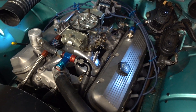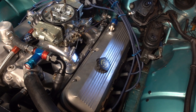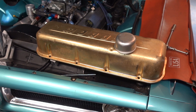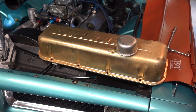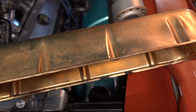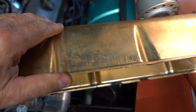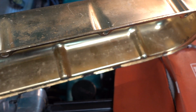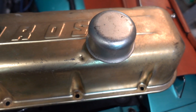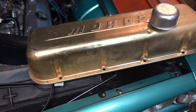It's much better with the vacuum pump. Valve cover 101 — the valve cover I put on when it was just laying here on the front was a GM cast aluminum valve cover with a spacer welded on the bottom, a pretty rigid piece. Here's a Moroso valve cover — one of the lightweight, cheaper valve covers that's pretty flexible. To put a valve cover like this on, you really need a softer gasket and you need to be real careful that you don't over-tighten it in any one spot. The quality of the valve cover you're using is really going to relate to how good of a seal you get.